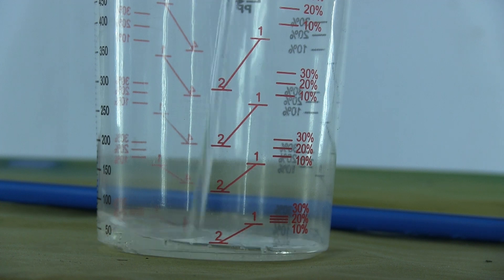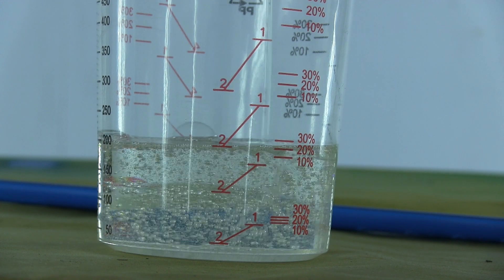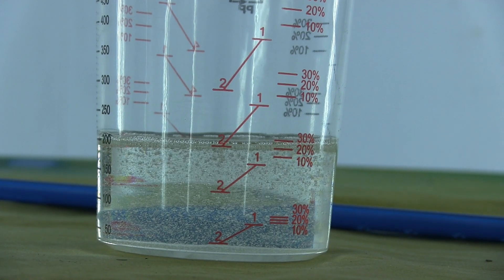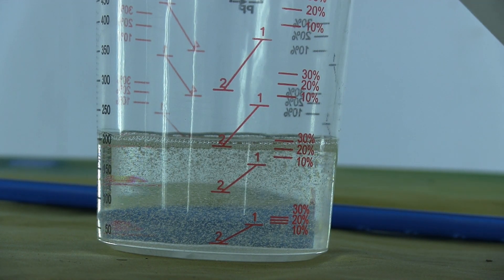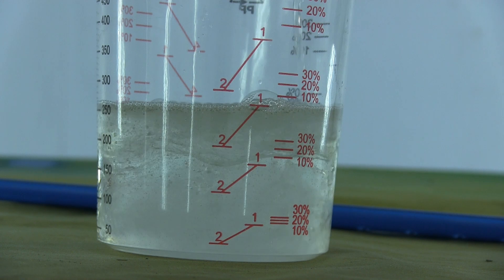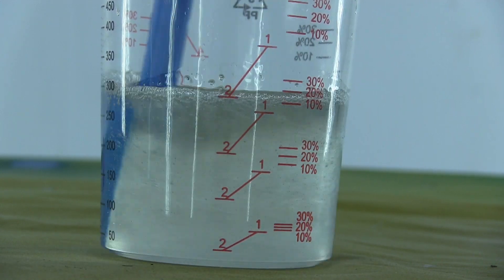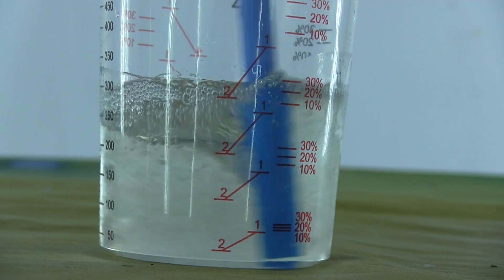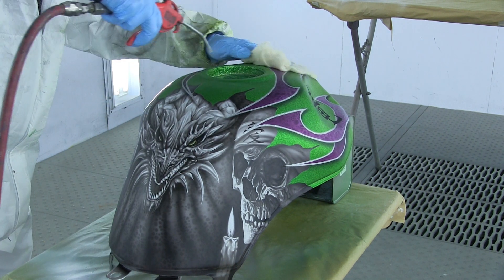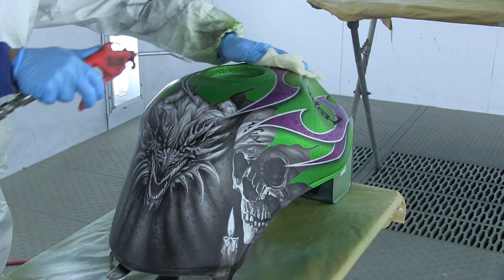I'm ready to clear coat now. I'm using a 2-pack acrylic urethane clear coat, and my mixing ratio is 2-to-1. When you hear people talking about a 2-to-1 or 3-to-1 or 4-to-1, please remember the 1 is always the activator or hardener — the higher number is always the body. So this is 2 parts clear to 1 part hardener. Please don't be tempted to put more hardener in on a cold night — it doesn't work like that. The optimum mixture is 2-to-1; the chemical reaction begins immediately irrespective of temperature. I've got about 2 hours to work with. I'm just using a blow gun and a tack rag — please do not use panel wipe or pre-clean over paint.